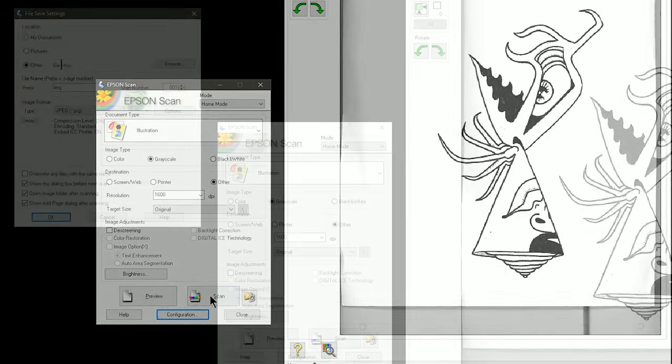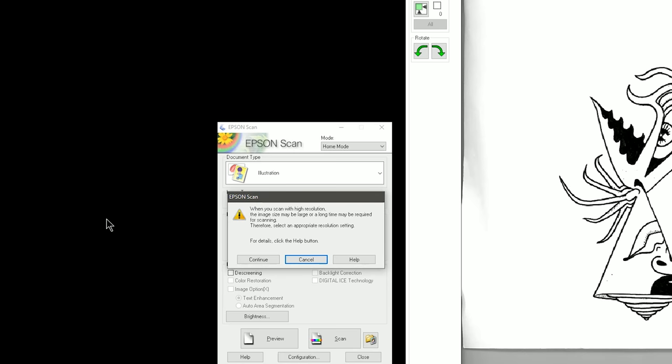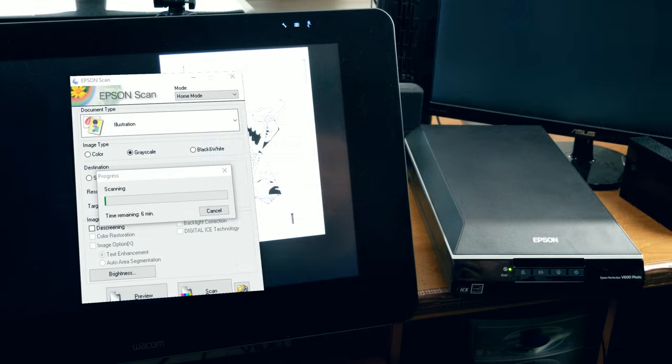I'll click on the Scan button. It gives me a few more options — I can choose where I want the scan to go, so I'll choose Desktop. Then I can choose the format. I'm going to choose TIFF because that's going to be the highest quality option. You could also choose PDF. I recommend not choosing JPEG because while that will be a smaller file size, it's also going to make the visual quality a lot lower. Because we chose a high resolution, it's giving us a warning saying it's going to take a while to scan — it's giving me an estimate of six minutes.